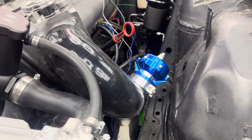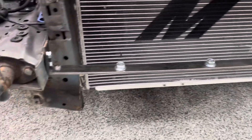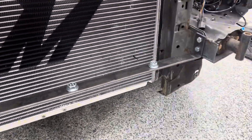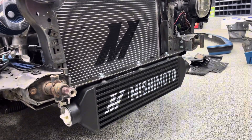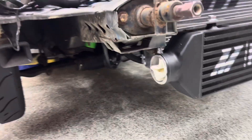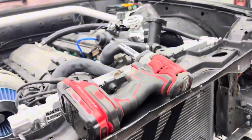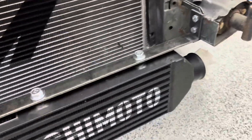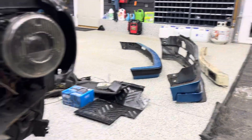That way I can run extensions off of the intercooler up into the bottom of the turbo and into where I want to run my charge pipe. Here's a clip showing the intercooler on — here are those pieces I cut out — so I can run a tube around up to the turbo and up to the throttle. Here are the specs for where these bolt placements go, and it does go right in the middle of the bumper, which looks nice.